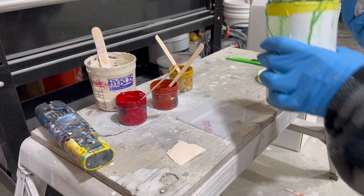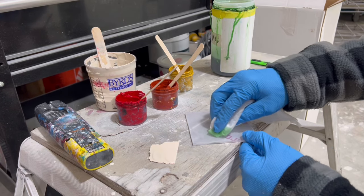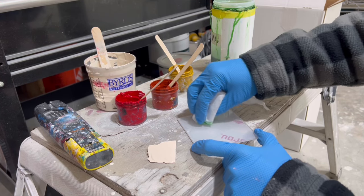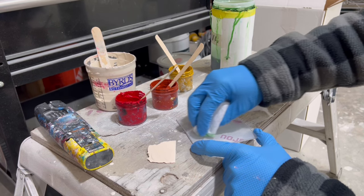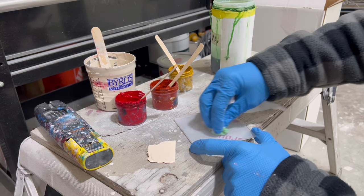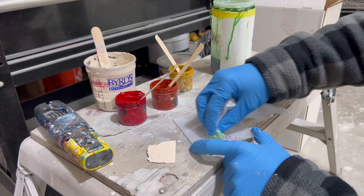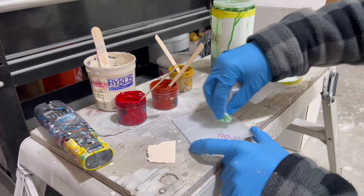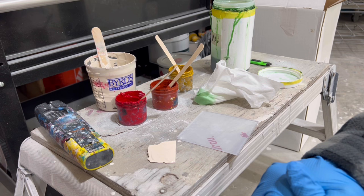This may be a little much, so all I'm going to do is smear it on here — kind of like when you're waxing a car. Smear it in and then let it sit, let it haze up. PVA is an open-air cure chemical and it's chemical resistant as well. So if you're doing a repair and you use PVA and try to wipe it off with acetone, it won't work — you've got to use water. I'm going to let that sit for a minute and then I'll catch you guys right back.